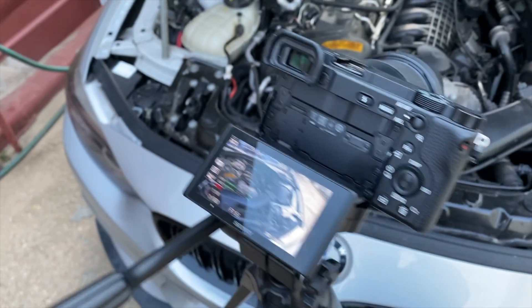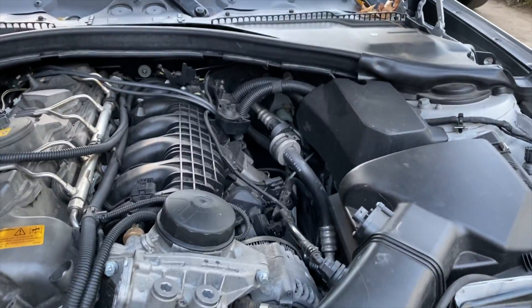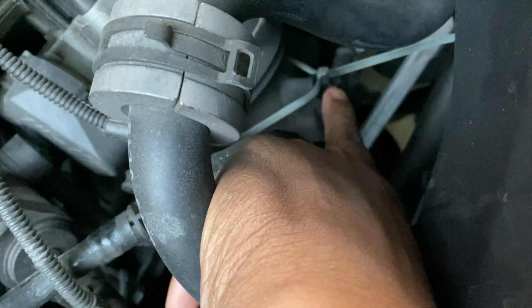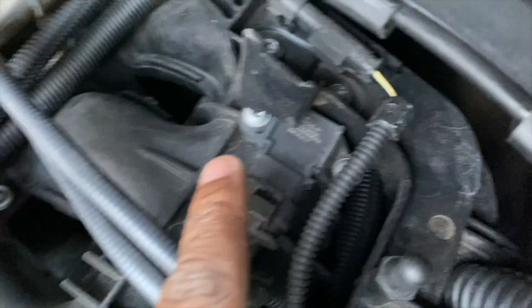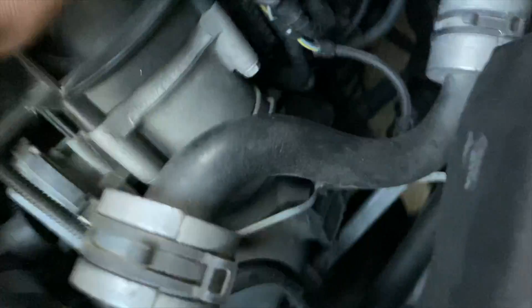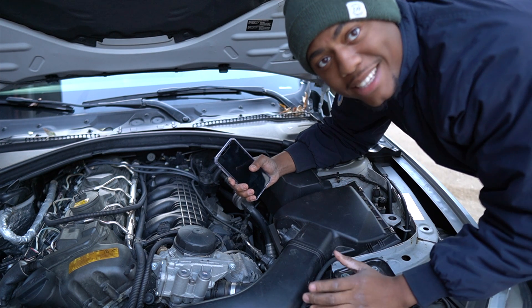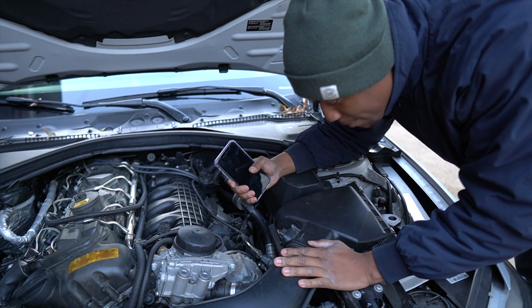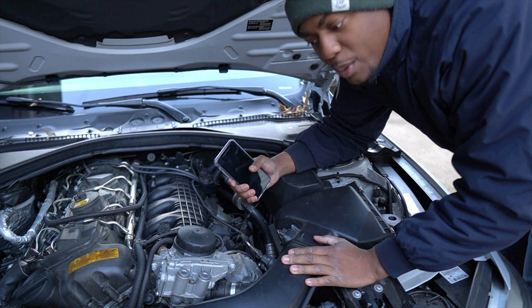This iPhone camera is no joke. So, in here — don't laugh at me — I lost the screw in the VRSF thing so I used a zip tie. What we're looking at right here is the T-MAP — this is pre-throttle body, and this is the manifold T-MAP. I was told I do not need to replace the manifold one just yet unless I'm pushing more than 30 pounds. So I'm going to take out the pre-throttle one. I was getting a code for mass airflow too high, and it has run a lot better without the mass airflow connected.